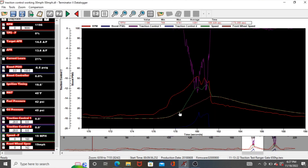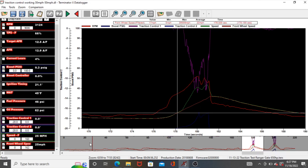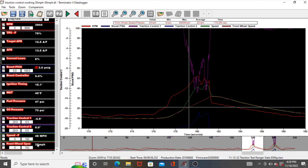You can see this line here as it comes up — the reddish color is the front wheel speed, the green one is the rear wheels. Down here if I click right here we're at 17 and 17. As it starts to come up it's at 25 and 25, and then right here is where the rear wheel speed starts to deviate from the front — that's where the wheel spin starts to come in. Here you can see 31 mph front and 32 rear; a little bit farther and we're at 35 front and 48 rear. Right here the purple line is starting to pull down the timing — traction control is pulling 5 degrees of timing at this point.